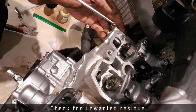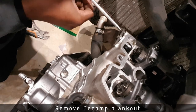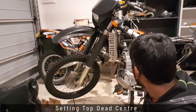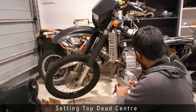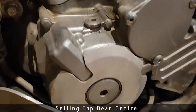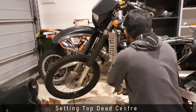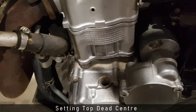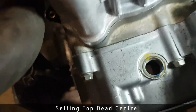To get to the left front head bolt I need to remove the blank-out which covers the hole used for the decompression lever — something you'd have if your bike has a kick start. Before going further, I need to make sure the engine is at top dead center. I take off the small cover on the engine side to expose the 17mm nut, which I use to rotate the engine manually. I know the engine hits TDC when I look through the inspection hole on top of the engine case and see a line marking top dead center with a 'T' next to it.